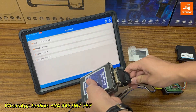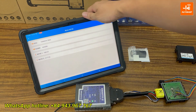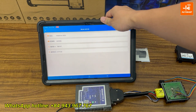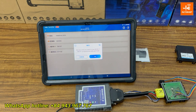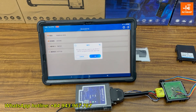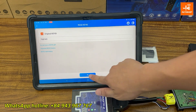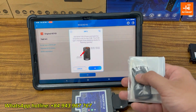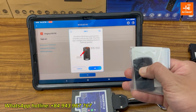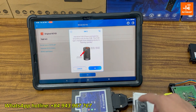Connect the cable to the Smart Fi2. On the screen, choose Key ID One to add a key, then tap OK twice. Now turn on the new smart key — the LED on the key will start blinking fast. Tap OK.